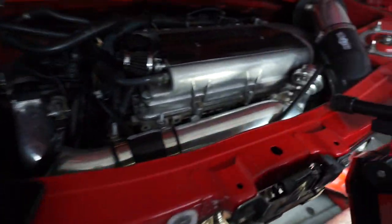Here's the seal — that's where it's getting worn and torn. I actually have a spare unit. I've had so many 2ZZs in my life. I'm gonna use the same old housing but clean it up with some brake clean. The thing that wears out is that seal right there. It has a pretty big gap before the seal. This engine has about 40,000 miles on it. I ended up buying a new seal — let me show you. I sanded the housing a little bit and hit it with brake clean — looks way nicer now. I used about 1,000 or 2,000 grit sandpaper to scrub off all the oil.